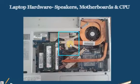The heatsink goes right on the top of the CPU. Keep in mind that when replacing the CPU or the heatsink, you must clean off the old thermal paste and reapply a thin layer of new thermal paste, and then replace the heatsink. We already have our mounting bracket that we used, so place it back in that. And once we've replaced our mounting bracket, that'll hold the heatsink directly onto our CPU as it needs to be.